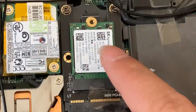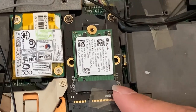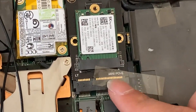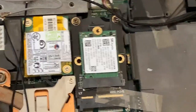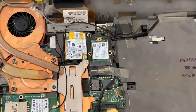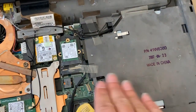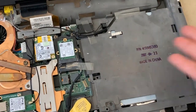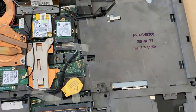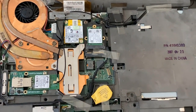So that's that. And here I've got — this is originally the wireless slot — a mini PCIe to M-keyed M.2 adapter. This does actually have mini PCI express lanes in it for the wireless card, but now I've got a solid state drive in there. That's how I got two drives in this machine. I could even cram in a third drive into the express card slot, if I had the rare T60, T40, or ultra bay drive adapter. Those are very hard to find. Someone was actually selling one on the ThinkPad forum recently, but I chose not to snag it because I don't need it.